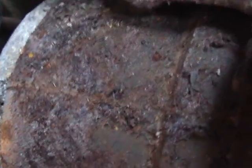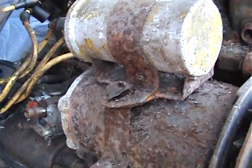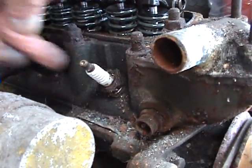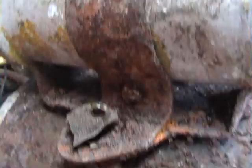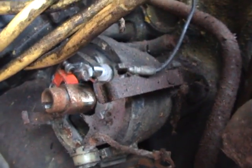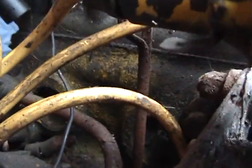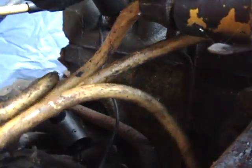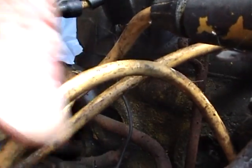I haven't got a rotor arm on, but you get the rotor arm on and get it pointing to number one cylinder. Then all you do is follow it — you go that way round. When the rotor arm — which has a peg in it — the peg is in the direction, so when it's there, that is number one. Number one on this cap is that one. So you just follow it round — so the next one round is that one.